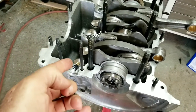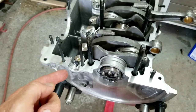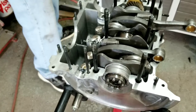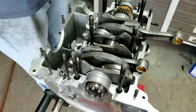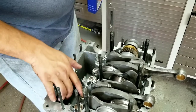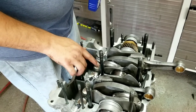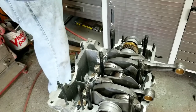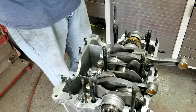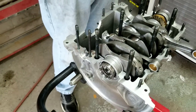On the lifters, some guys use oil, some use special cam lube. We use a little bit of oil and STP mixed — you don't want 100% STP because it's so slippery your cam may never break in. STP has ZDDP in it which helps make sure the cams lube properly during break-in. It gives it those first few minutes of protection. STP and oil mix is something I learned doing V8 engines.